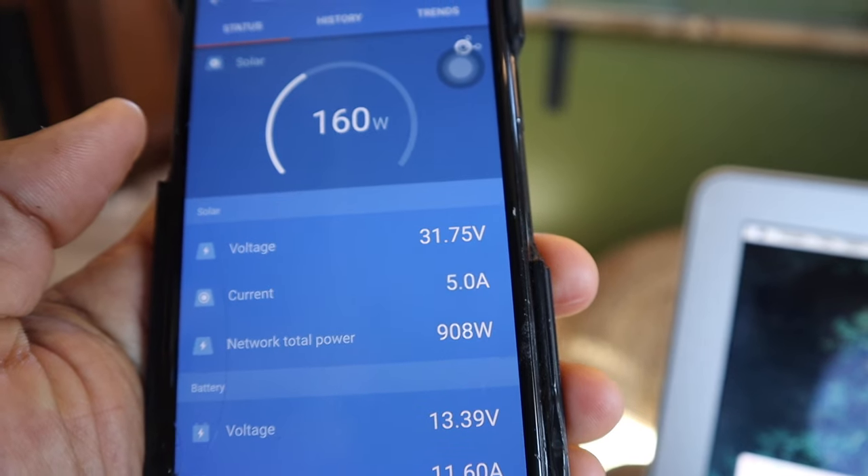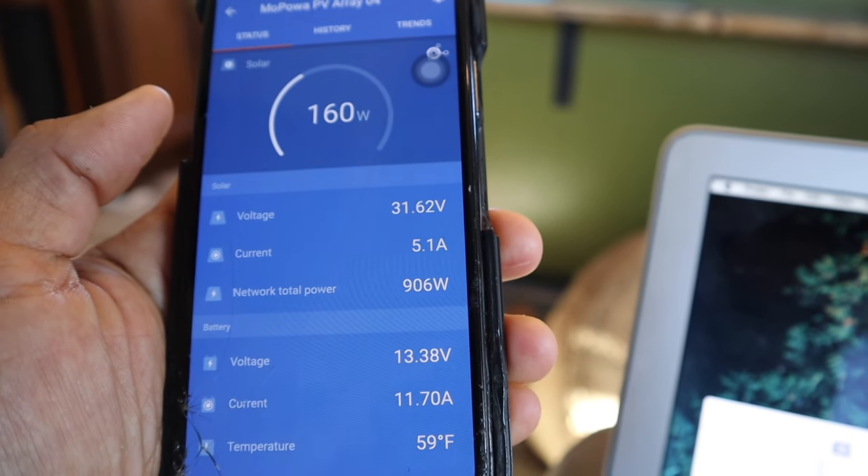When we're hooked up to utilities — 50-amp power — we can run all those and stay really nice and warm. But when we're dry camping and not plugged into any utilities, just pulling power from the sun and converting that energy through our inverter, we've got our 800 amp-hour battery bank — we can't really run electric space heaters. Anything with a heating element typically draws a lot of power. Our propane furnace, just the motor to blow the air, does draw a significant amount of power. We lose about 20% of our charge overnight just from our big residential fridge and our router. If we were to run our propane furnace, we would probably lose an additional 10 to 15% overnight. If it's not really sunny or a little cloudy the next day, we can't take advantage of that whole battery bank and we'd have to run our generator. That is why we opted to go with a diesel heater.